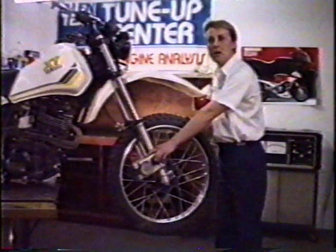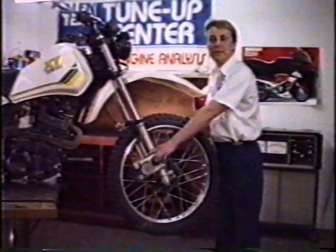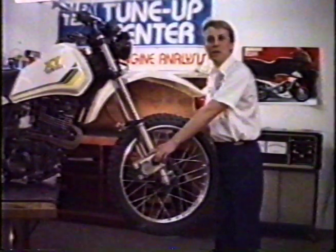I've got it set up now mainly for off-road tricky courses. The front wheel gets going quick, goes about 30 miles an hour. That's all I need. For long distance, world record attempts, etc., I go with about a 4-to-1 ratio, and the wheel spins about 42 miles an hour there.